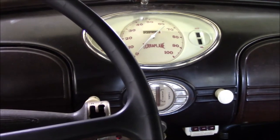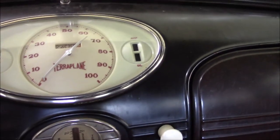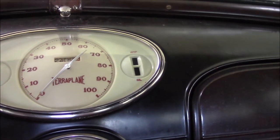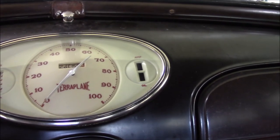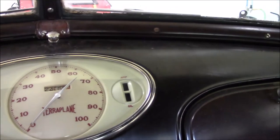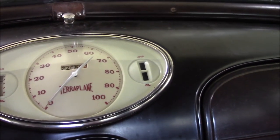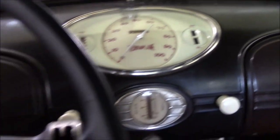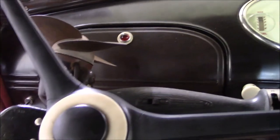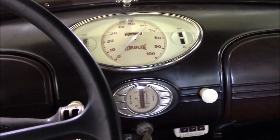This car has 4.11 gears with a three-inch bore, five-inch stroke motor that's happiest in low RPM ranges. You start getting it up to around 3,500–close to four grand, and you're winding it. It tends to stay 45–50 miles an hour at top speed. It will go faster — I've talked to old timers that would get these up close to 100 — but with a babbit-bearing six with dippers, that makes me nervous. Here's a downfall of generators — that's why they banned them. At lower RPMs, generators don't make any power and the amp light will come on. If you're just idling this car when it's warmed up, your amp light will pop on here and there. That's a little bit of the Terraplane. I hope you enjoyed the video — hit the like and subscribe button and have a great day.